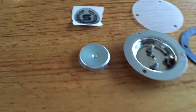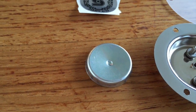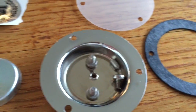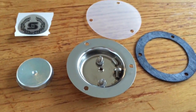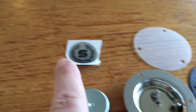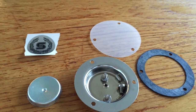Here's what you get in the approved proper Fiamm kit. Starting from down here: this is a little bell that goes inside to compress against the horn, and that little dimple you adjust with this little doohickey right there. There are three screws to hold the housing on, then you've got a gasket, the mylar, and then this you put on the horn when you're complete to seal everything up.